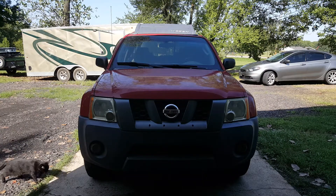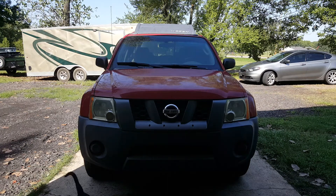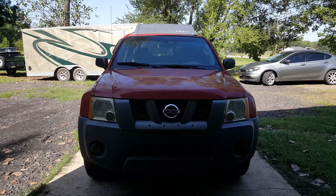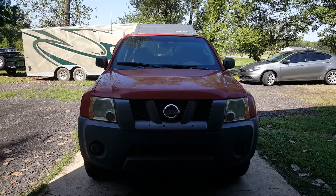I'm working on this 2008 Nissan X-Terra. This is just a rear-wheel drive, doesn't have the four-wheel drive. We've got a screeching, scraping noise coming from the front. I have not even driven this yet, so I'm not quite sure what's going on. Some information I know is that the front brakes and the rotors have been replaced, so those are all new, and apparently it was making some noise. The brakes were replaced and the problem even got worse. So we're probably just going to go drive it and see what's going on.